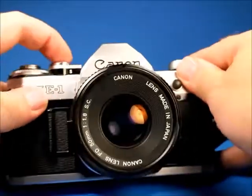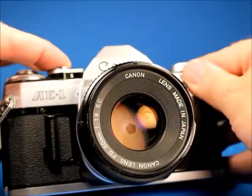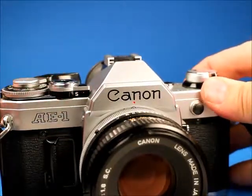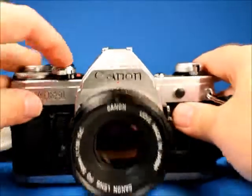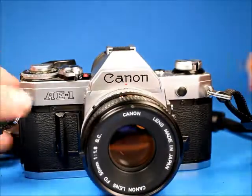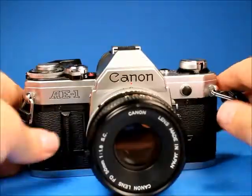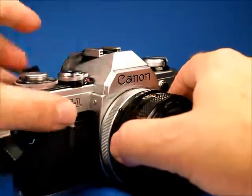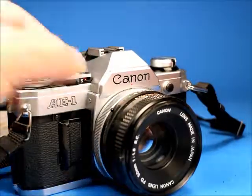With the bulb setting it stays actuated as long as I hold the button down, and completes the cycle when I let up. The shutter seems to be working well. There's just that issue with the curtain. The self-timer test shows the light blinking and it completes its cycle properly. It's also got a shutter lock so that you can't accidentally actuate the shutter in your camera bag, and you simply flip that back.